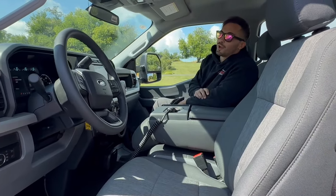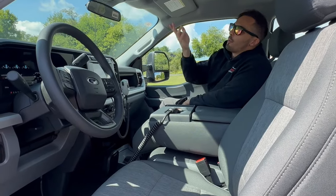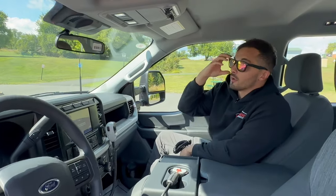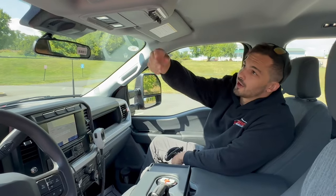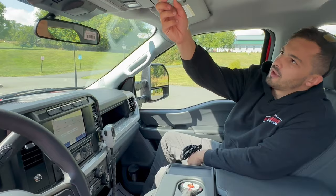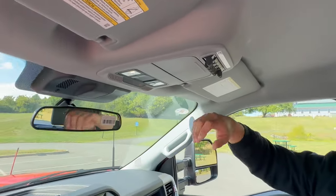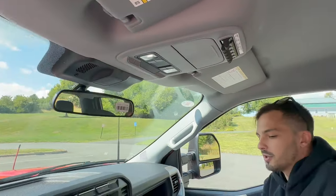As I was telling y'all, we really don't have a whole lot going on in this truck — I definitely mean it. All the lights are hooked up to the OEM aux upfitter switches here in the overhead. Again, this is all factory Ford. The first one cuts your headlights for the plow. They've broken it down so you can flash red, introduce the white, introduce the amber. You can make the rear lights on the back bumper come on solid scene for when you're backing up, and you can kick on the scene function for the light bar.